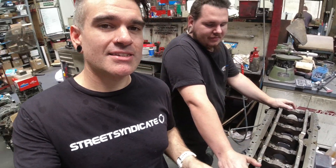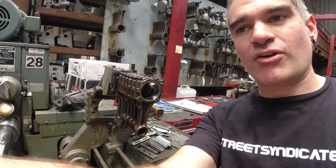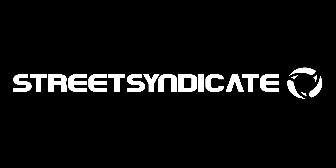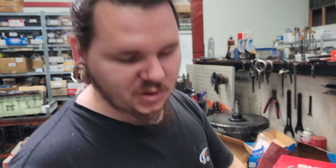So that's basically everything done to the block — everything's ready to start reassembling. We've checked all the clearances. The crank's good, the main tunnel is good, it all checked out okay. We've got the new RB26 rods set up that Aaron has resized to fit my crank with the correct clearance. We've also set the ring gap for each set of rings for each cylinder, so they're all looking good now. I think the next video will be starting to reassemble the bottom end for this engine, so make sure you stay tuned for that. Thank you once again Aaron. See you next time!